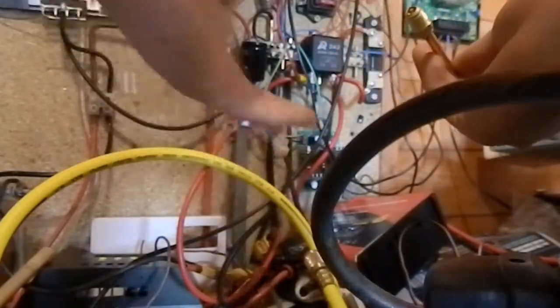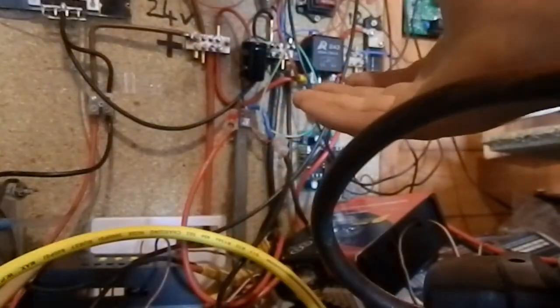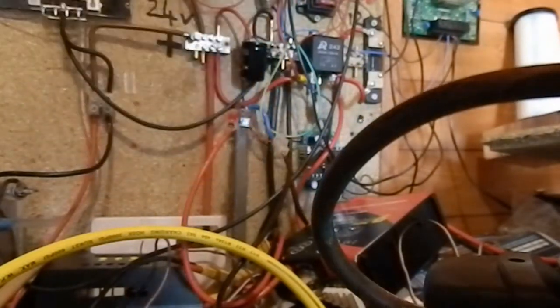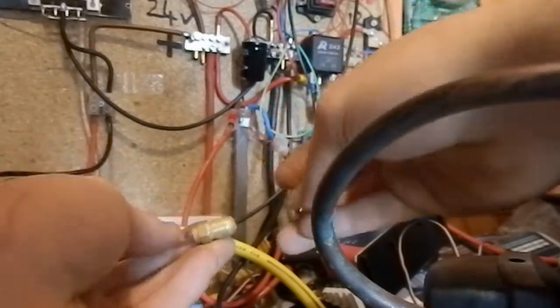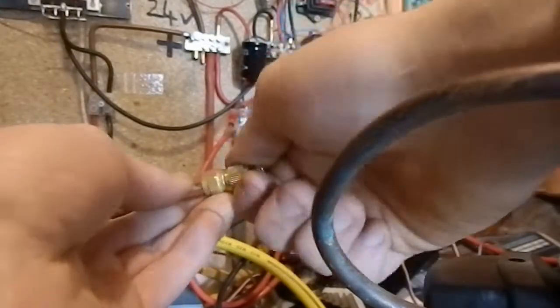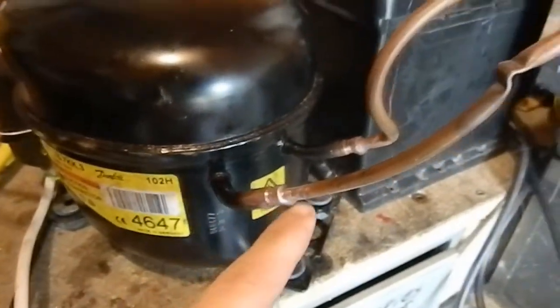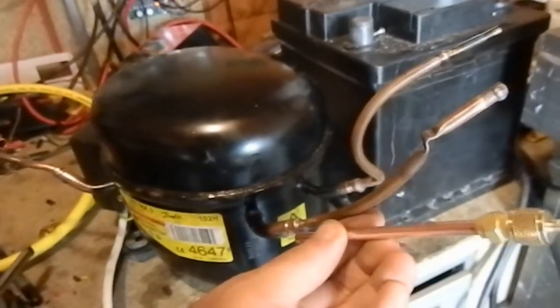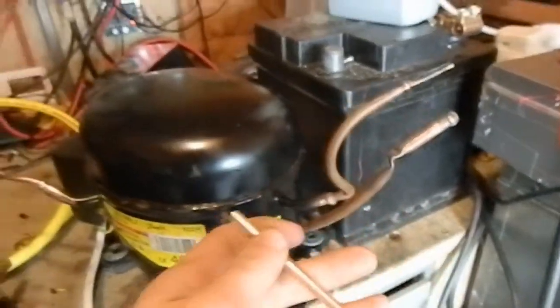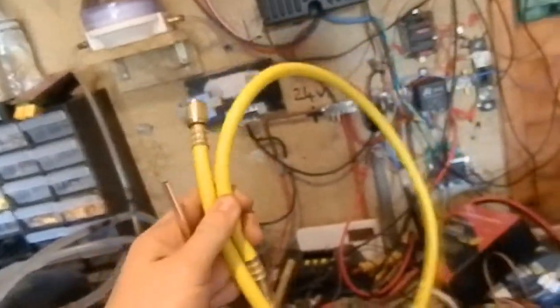The only thing that's bothering me is I might not be able to get this hose to fit onto the refrigerant can I've ordered, and the tap for the can — I'm not sure if that will fit either. This does come with a valve inside that you could remove if you want. What will happen next is I will cut this off — my torch is hot enough to un-braze that — and this service valve will be put inside to let me charge the system and hopefully put it under vacuum as well. I'll need to find some way of connecting this up to another compressor which I'll use as a vacuum pump.